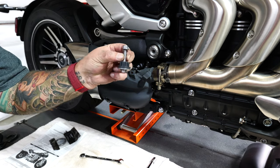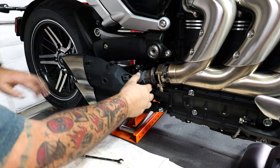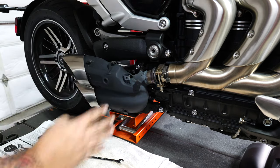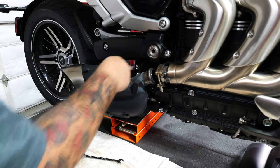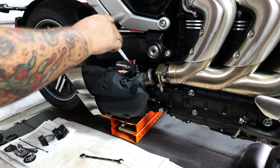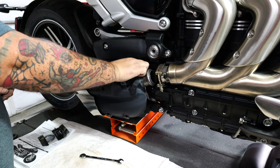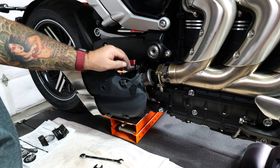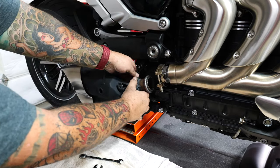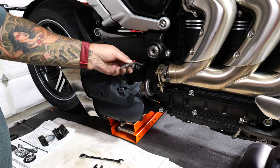So here's your O2 sensor. I'm going to bring it down a little bit more so that I can get to that at a good extension, and that way I don't have to hold this thing. So now we'll just get a wrench on there — that's a 17 millimeter. These shouldn't be in there super, super tight, so you just kind of pull it away and twist it out. And there's your O2 sensor. When you put it back on, you'll just twist it in a little bit before you put it back in.